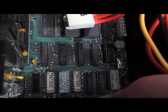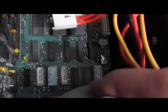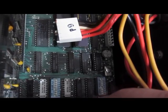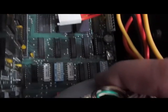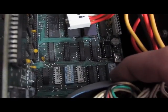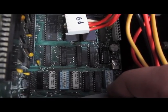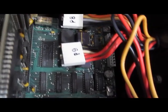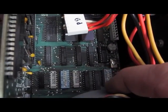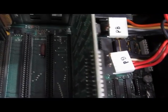Some of us would set these switches to basically no RAM, which would bypass the memory test. Then when you'd boot, it would come up fairly quick and you'd run a little program you wrote that would change the settings in RAM to tell the OS it had more memory than what was actually available. Remember some of the old programs like WordStar — you'd put 640k of memory in there and WordStar would crash, so you had to have your debugger out and modify some of these programs right from the factory to get them to run on more memory than what they were developed for.